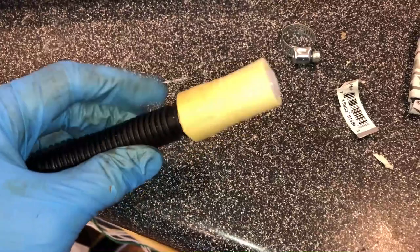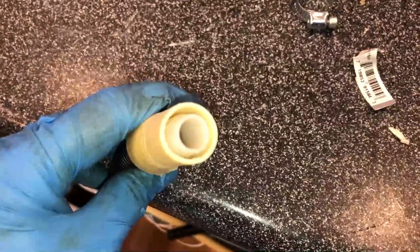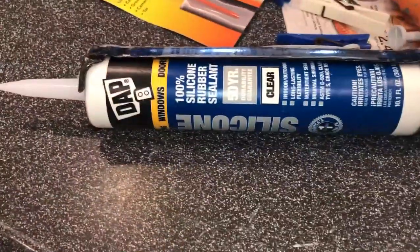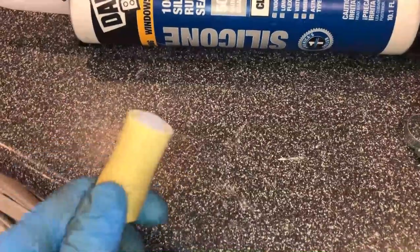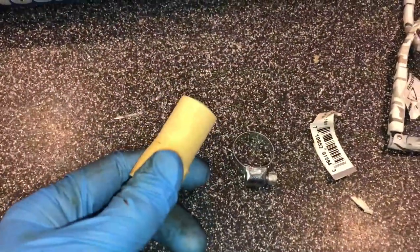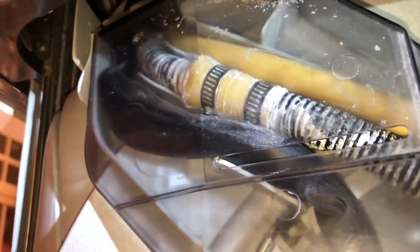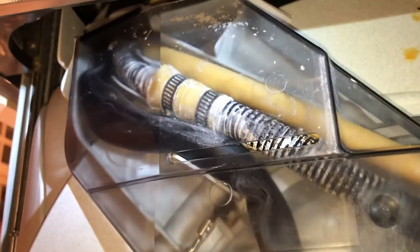So I'm about to do the repair, and I've got a double system now. I went out and got a one-half inch barbed pipe, barbed on both ends. I've inserted that in the inner diameter here, and I've got a larger pipe on the outer diameter. I'm going to use silicone as well to act as a sealant, although I know it's not strictly necessary — but hey, why not? And then I'm going to put some pipe clamps on the outside as well, so I think that should be a really tight fit. Here's the completed repair. It's a bit messy unfortunately — clear silicone didn't work so I had to use white. I've got two pipe clamps on there and the barbed fitting is super tight. I probably don't need anything but the barbed fitting, but I've got extra protection there.